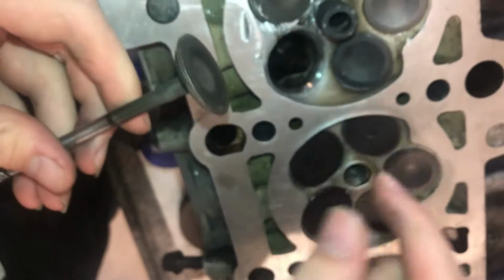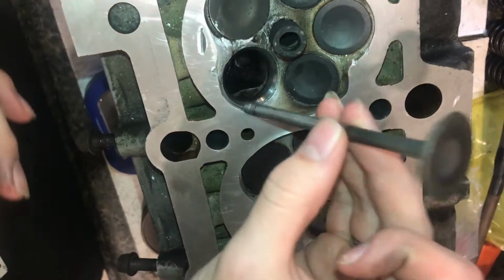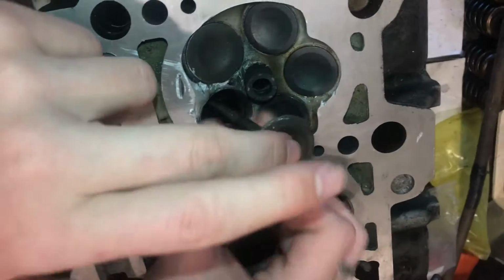I can still feel that there's grit on the sandpaper, so we'll keep going. But we'll put a little bit of water in there so it'll clear the chips and the dust that come from there. It'll keep your sandpaper grinding a little bit more effectively.